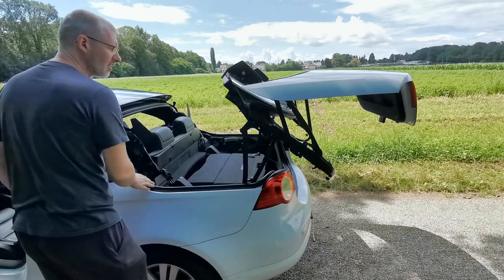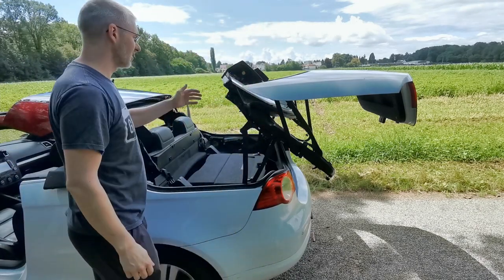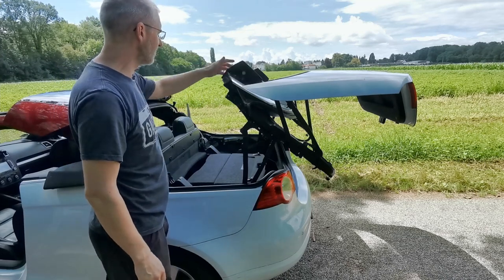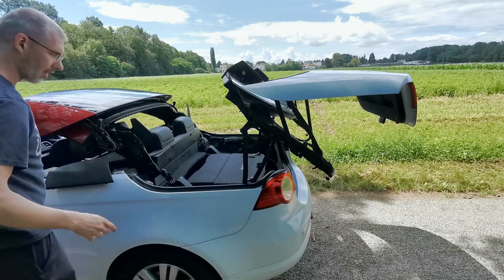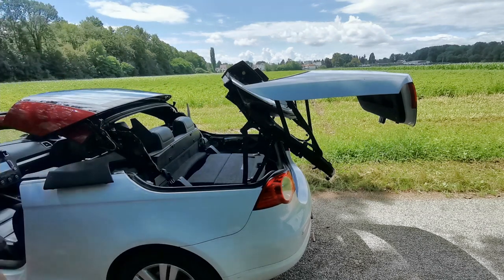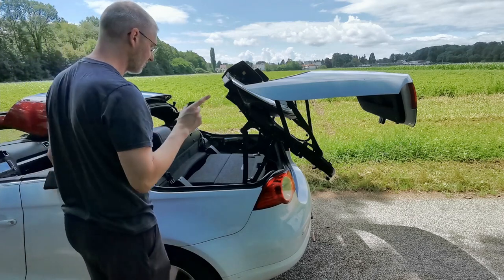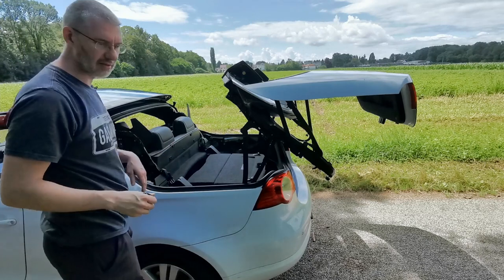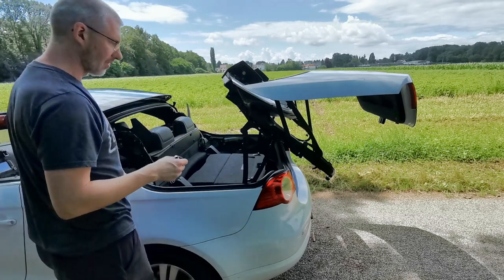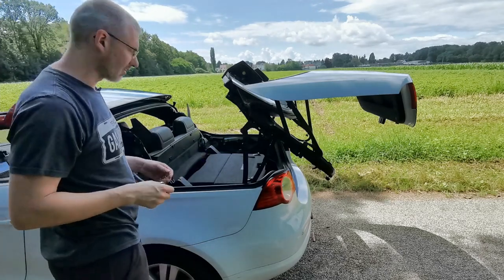It's really nice to get to all these seals here, and the linkage. You can also get to this mechanism, and adjust these flaps if something pops out. Now, if you don't want the roof to complain in a minute — turn the ignition off and take the key out. This prevents the pump from having a timer running telling it it's overheating, which gives you an error message like pump overheating or roof mechanism overheating on the display.